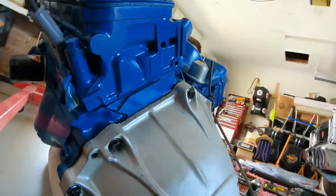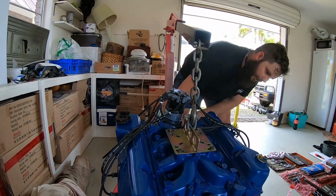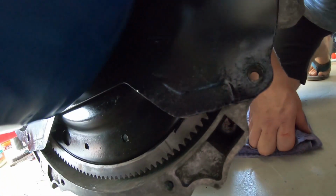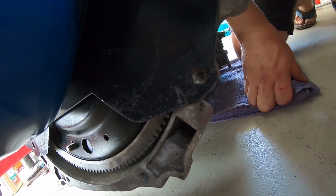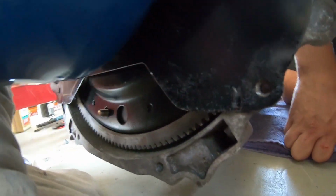Okay, let's go to the next one now. 15-16 on the harmonic balancer, the main crank bolt, and we'll turn it 90 degrees. Everything's clear, bro, yep. I'll watch it, I'll tell you when. I'm listening out for any funny noises now too, in case the studs hit. Okay, a little bit more. You can see it already to get the nut on. Yep, perfect. Sweet, another nut.